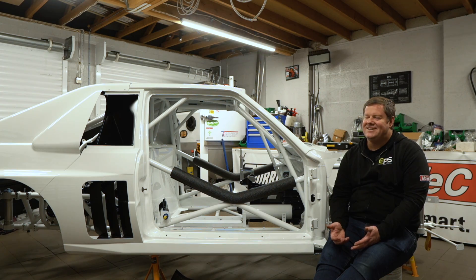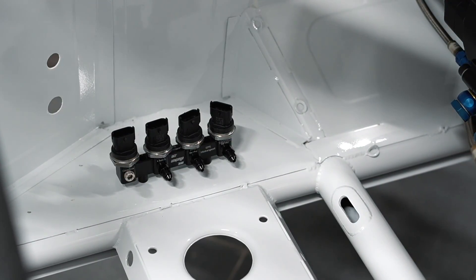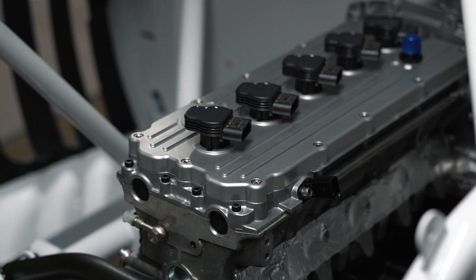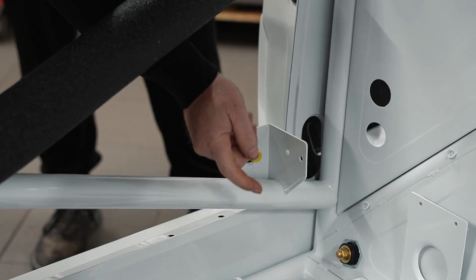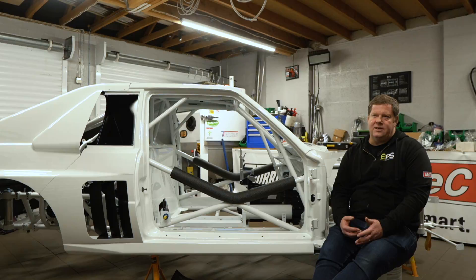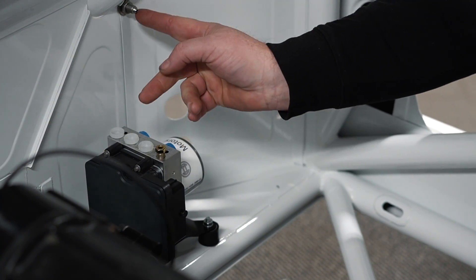Once we've got the major components in the car, we need to do all the plumbing for the fluid systems, the braking system, the air jack system, and the fire system. We've put all the major components in and now it's a matter of ordering the right fittings and working out where to run the lines through the vehicle — you don't want to be stepping on hoses, you don't want them in vulnerable positions or in the way of maintenance. The plan is to have them looking neat and unseen when finished, hopefully over the next week and Christmas.